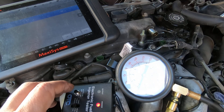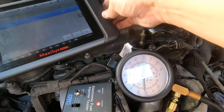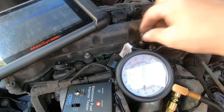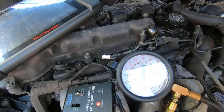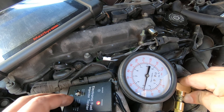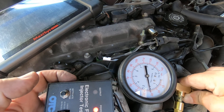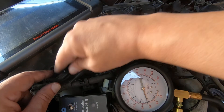I'm going to hit the button on the tester — it dropped down to right at 32 PSI. So it lost 10 pounds of pressure. Going to the other injector: turn the fuel pump on, get pressure back up, turn the fuel pump off, let it come to its stabilized state — same spot, about 42 PSI. Hit the button. Okay, 32. So far, so good.